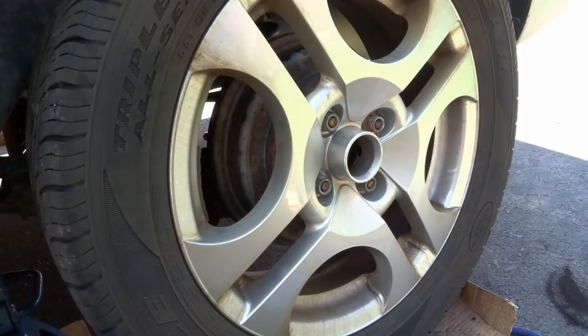To finalize, lower the car down and give it the final tightening. With aluminum type rims, if you have a torque wrench, aim for about 90 ft-lbs and no more than 120. Aluminum rims are pretty delicate, so they're a little lower on the tightening scale.